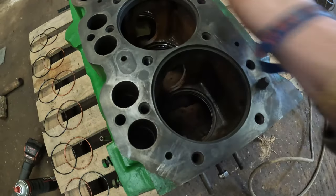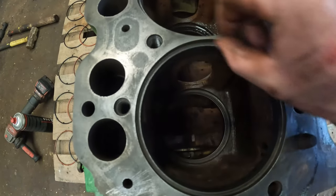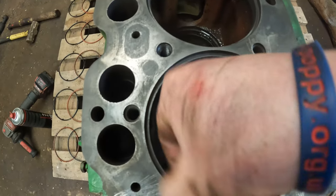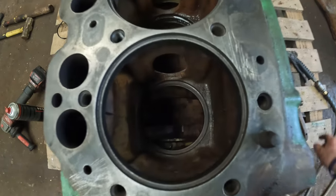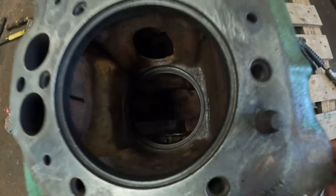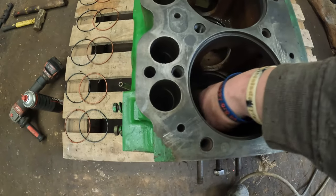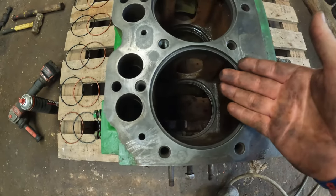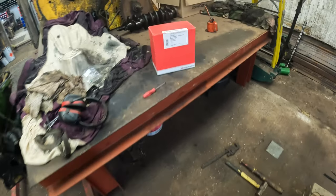So that's just one or two of them wire-wheeled off. I wasn't going to do the whole lot because it would take forever otherwise. You just want to get all the mating surfaces. Like if there's a square corner, make sure you get a pick or something right in there - I've got this on my pocket knife. Get it right in the edges, especially down in the bottom of the bores where the O-rings go, because that seals the oil from the water - you don't want coolant mixing.